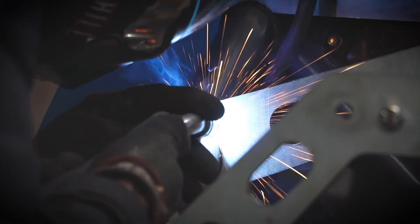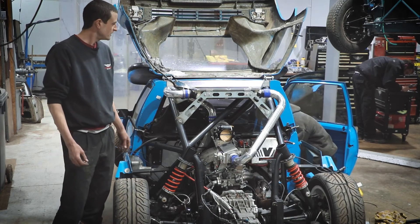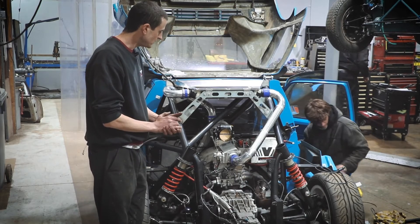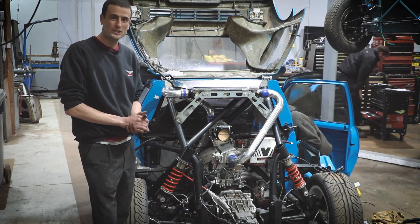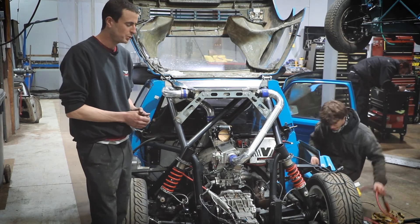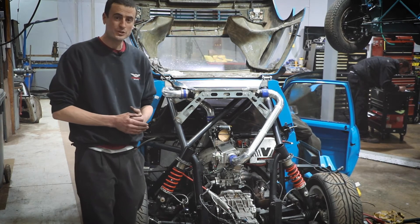As you will have seen in the video just moments ago, Ed has done the welding here and attached all these brackets, so this can be mounted. It does need to come off again unfortunately to paint it up. There's a lot of work to do around reducing noise in the signals for the ECU. One of those things is we've brought all the earths to one point, which wasn't the case before — that should help a lot with the signal noise.